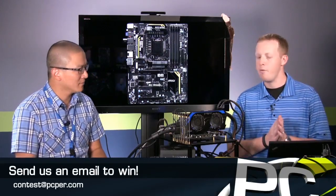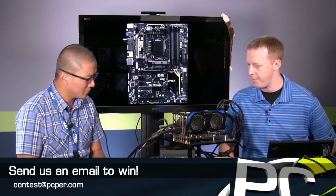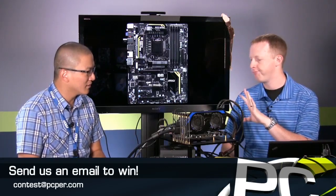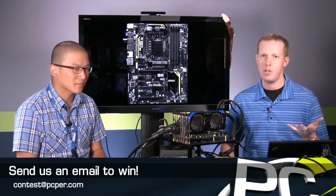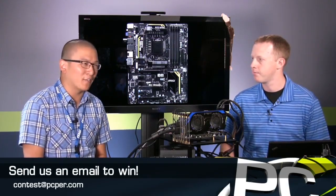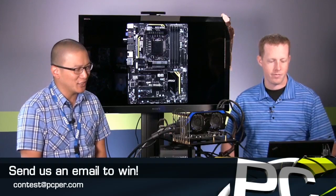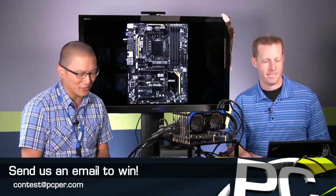All right. We did have one question that came up. They were asking, will this support dual GPUs at full x16 speeds? The answer is no, I assume. It's Ivy Bridge. So there are no bridge chips or anything in here to expand that, right? That's generally the case for almost all of the Z77 motherboards. Yeah, any Z77 board, frankly, below $250, it's all going to be like that. But with PCIe, unless this is for folding, unless you want every ounce of performance out of the board, if this is for gaming, you'll never tell the difference.